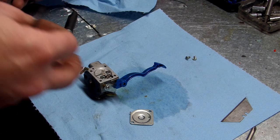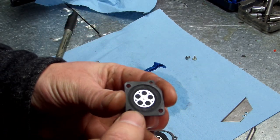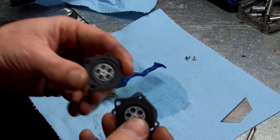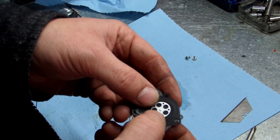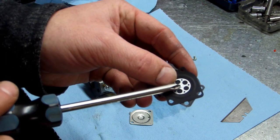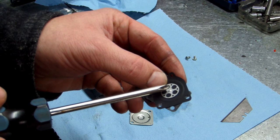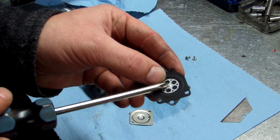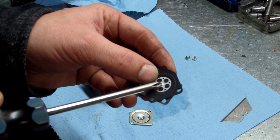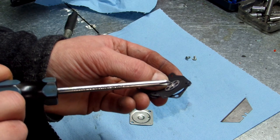Alright, when you put this back on, you want to look carefully. Your gasket is on the bottom. And when you get your kit, you also want to make sure this metering diaphragm, this little nipple in the middle right here, you want to make sure that it's smooth, like low to this plate right here. They have a version that's longer, that sticks up probably 1/4 inch. You want to make sure yours is the one that's not sticking up. It's like maybe a 1/16, if that, if that makes sense to you. The other one sticks up to about right there. It's pretty long, that nipple.